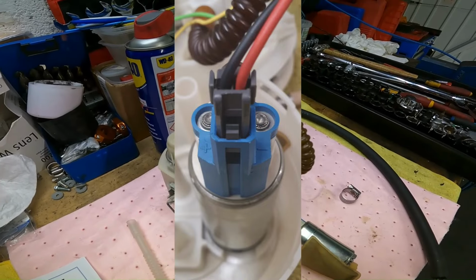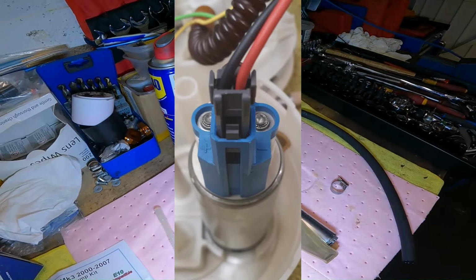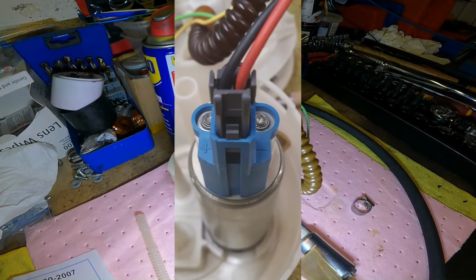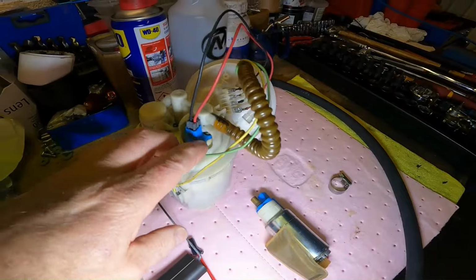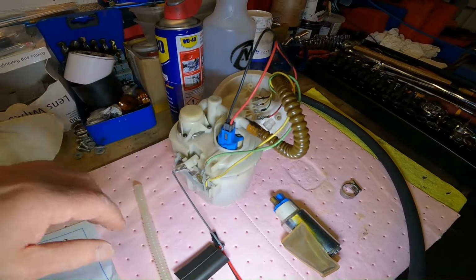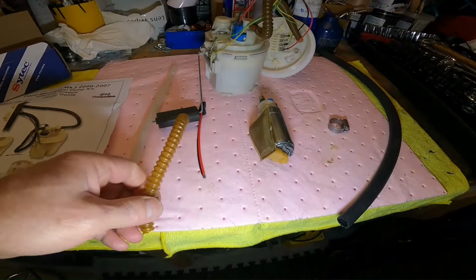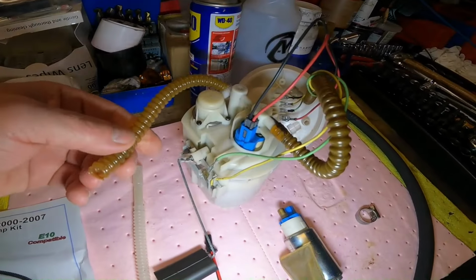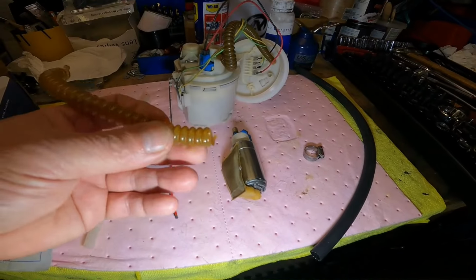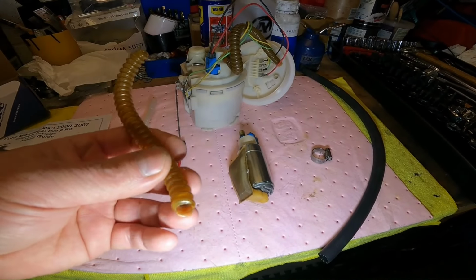Yeah, I don't know if you can really see that, but like I say, I'll put a picture up of a close up of that. So yeah, the reason for upgrading the hoses is because the original ones, that's come off of there, look, they split about quarter of a tank level, and once they've got split in them, they start sucking in air.